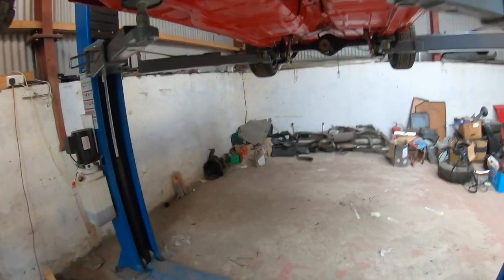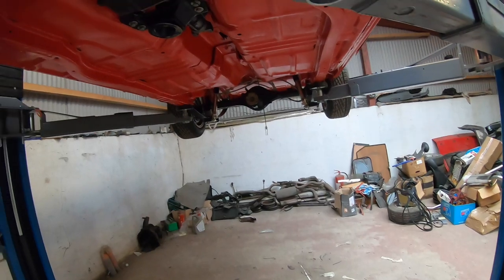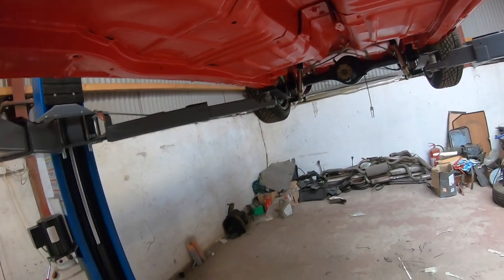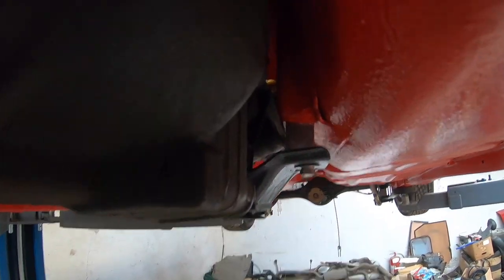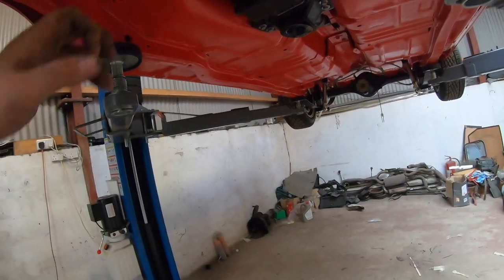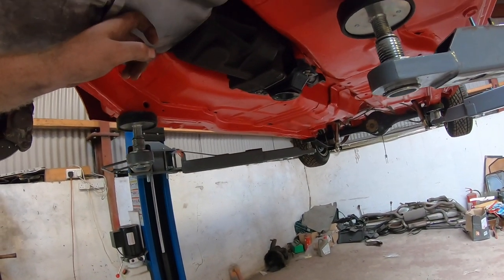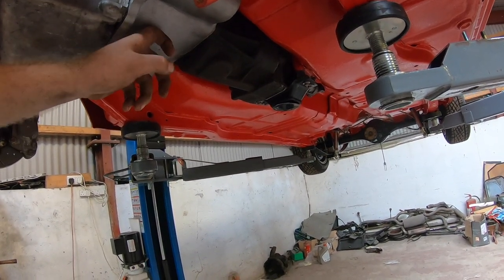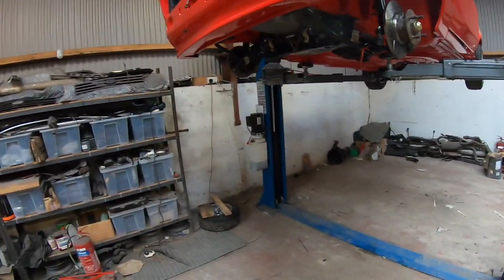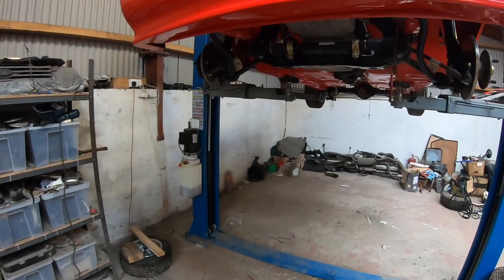and then that'll let me get it up to the right side to present it to said fuel pump. Because this is a Type 9 into a standard Mark II shell, everything was a bit tighter really, but we've had to use the lowering blocks from Motorsport Tools for the 5-speed conversion, and without this bell housing you will not get a Type 9 into a standard Escort tunnel. It just doesn't happen, trust me, been there. I've tried 3 bell housings and only one of them fitted.